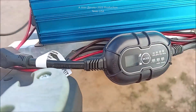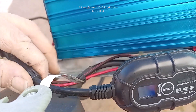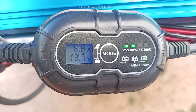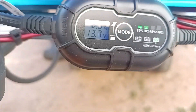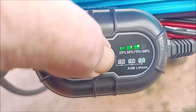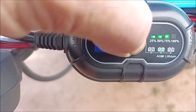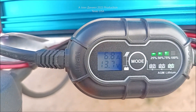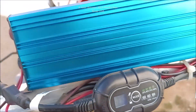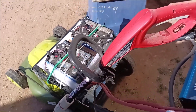I'm going to focus on that and you're going to see how we charge up. Normally I would park the mower under the carport, but we're going to see right there that it is putting in 6.8 charging amps at 13.7 volts. I've got lithium pre-selected right there, but you can go to lead acid, AGM, and then lithium. Default setting for lithium, if you don't have this on your charge controller, would be AGM — so you can use AGM on a lithium battery. If you have an AGM charger, use it on lithium batteries; they're fine as long as you have a standardized BMS — that's battery management system — controllers on them.